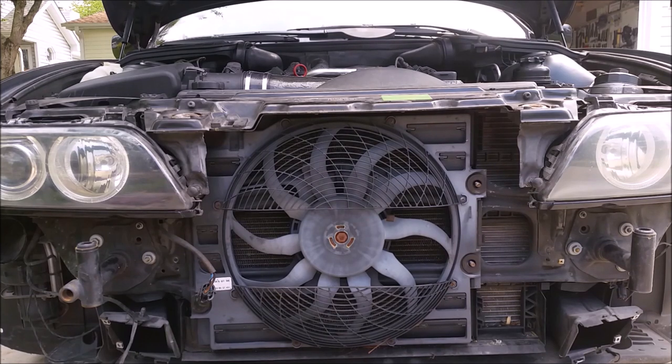What I'm going to do is replace this fan with a slightly smaller 12-inch fan that will run all the time — as long as the engine is running, that fan will be on. The electric fan conversion I did behind the radiator only runs when the car reaches 200°F, in conjunction with the 190°F thermostat. That fan is the primary cooling fan. The smaller 12-inch fan is mostly there to ensure airflow across the AC condenser and to supplement the larger 14-inch electric fan.